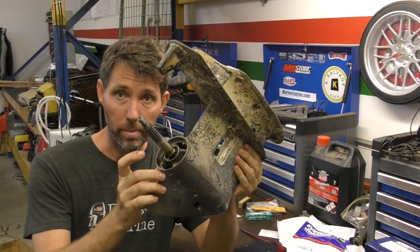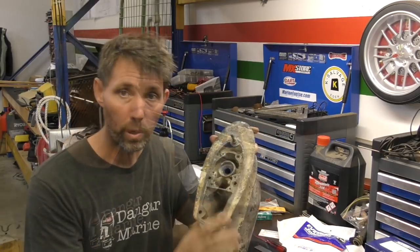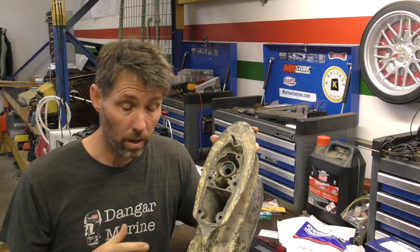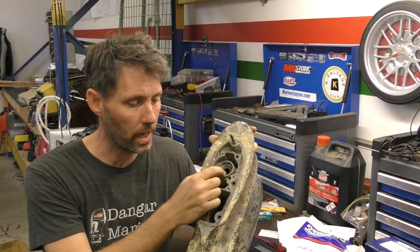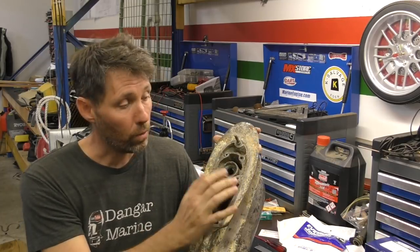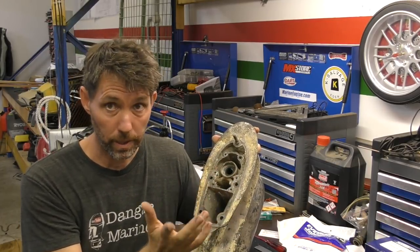We'll head over to the bench and I'll show you what I'm thinking. Because this lower unit is leaking, at a bare minimum we need to get this bearing carrier out so we can replace the oil seal there. We also need to get the second oil seal out from the drive shaft. The seal puller I've got isn't great because it's designed to lever against an edge, and the edge here is quite thin, so I don't really want to use that to get the deeper one. It wasn't too bad for the shallow one, but it's going to be even worse for the deeper one. I've ordered a different seal puller, so we'll see when that arrives.